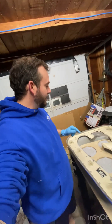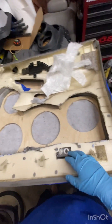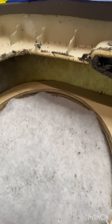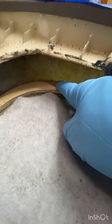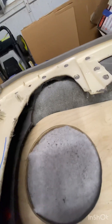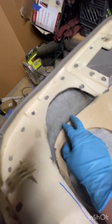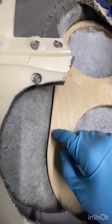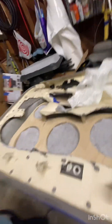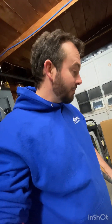I took my door panel back off so I can put some fiberglass on the inside of the panel. I cut this out where I can get in and get the edge of the wood where it was fiberglass too. I'm going to add fiberglass resin and chop mat all the way on the inside, and fiberglass it to the wood on the back side all the way around so it's even more sturdy and I get a tighter bond. Then I'll lay down some more glass and let it sit.